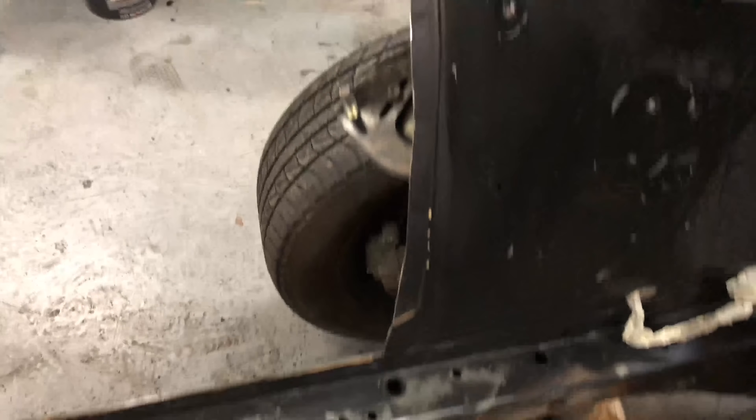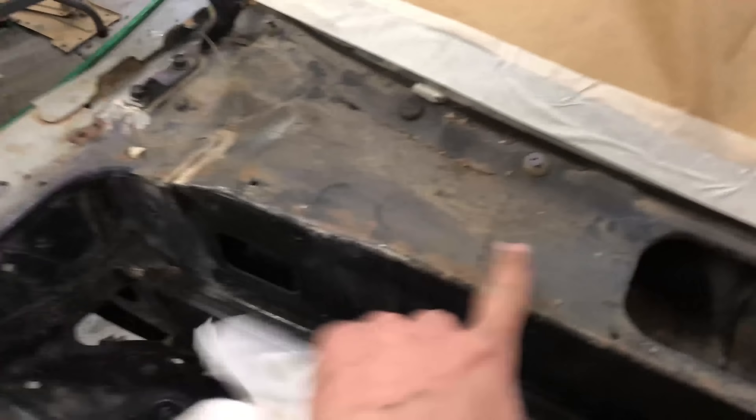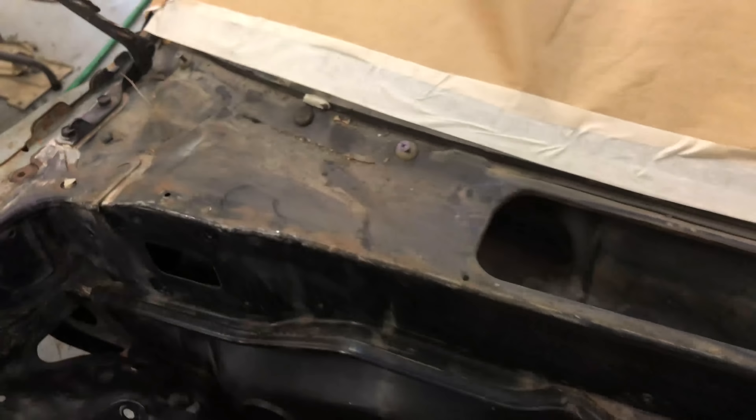I picked up a new phone — let me know how the audio and video looks. Here she is cleaned up: cut edges, sanded everything down, taped everything off. Right now I've got this covered in some lacquer thinner or mineral spirits and I'm just gonna clean her off, because you don't want that stuff under your paint. It's super dirty so I might use a separate rag, then hit it with the mineral spirits before I start spraying.